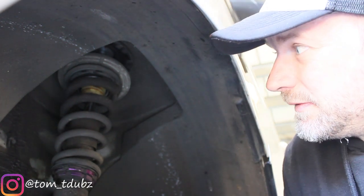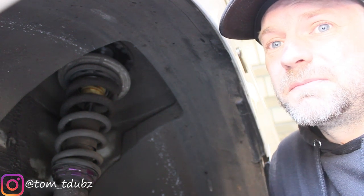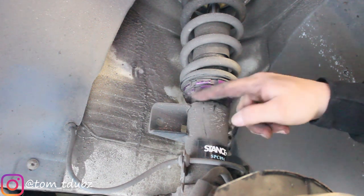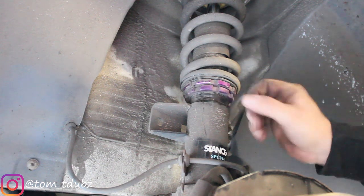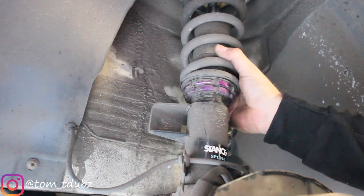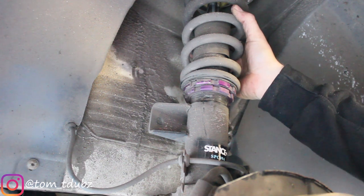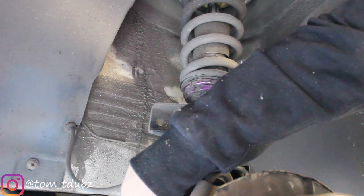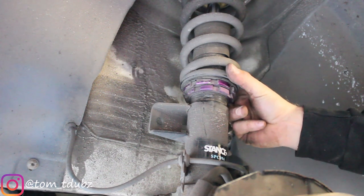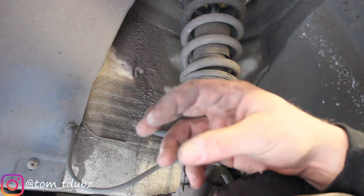I'm not going for ultra low touching the ground here — I'm literally trying to better the Stance Plus kit. This is the Stance Plus kit. As you can see I am a finger depth, about 10-11mm off the bottom of the strut. I've also got the bottom adjuster I can get rid of to get even lower. The problem is this spring is now full — it's wide open, so it's quite bouncy. So I'm going to drop it through the hub, 20-25mm maybe, which means I can raise this up 25mm and compact the spring slightly, thus hopefully getting rid of a bit of the bounce.